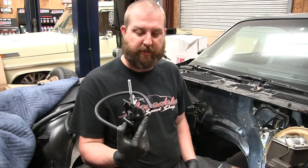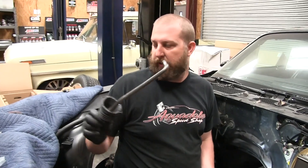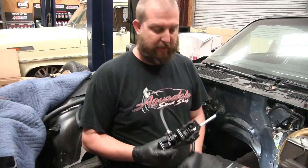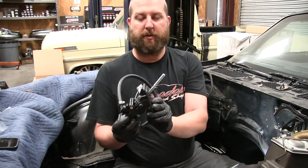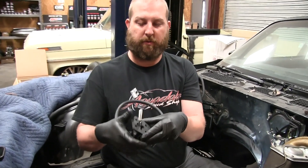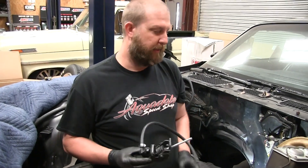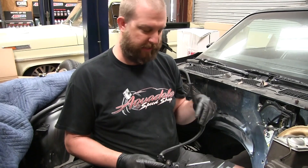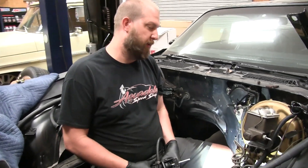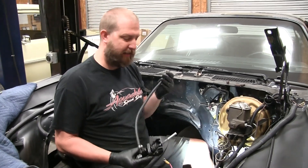Hydraulic Master Cylinder — getting rid of the big manual rod and all that. It's got a plate; you go through the firewall, this will pinch on the firewall through the factory hole, then you pop two new holes in the metal, put the lower two bolts in. You can't really see it and it's in an awkward position — I'm a big boy laying upside down under a dash of a car, so nothing about that's going to be fun.